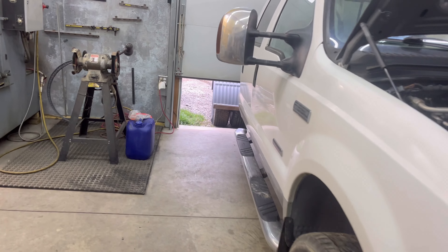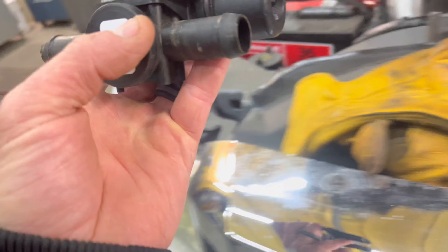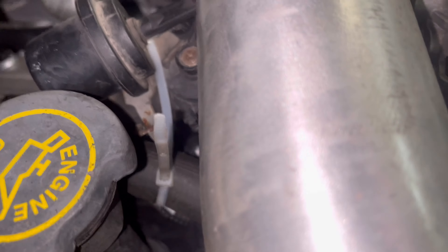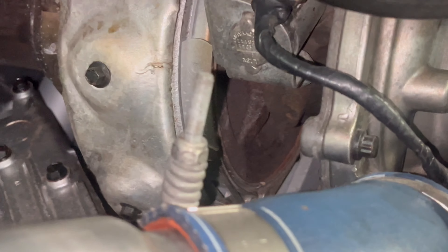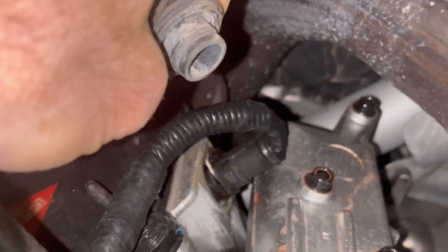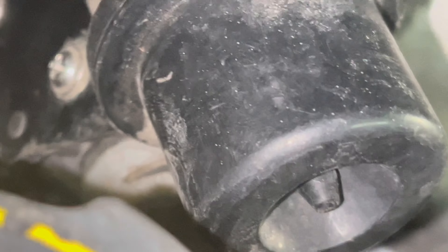We got a little bit of success — we're at the shop with the truck and the double stacker. They found a heater control valve — wish I'd had that on the side of the highway. Let's see if my zip tie fix held up. I need to rinse off the coolant residue. Looks pretty dry in there — both lines. We just drove about 50 miles since we were on the side of the highway and the repair worked. Good deal.